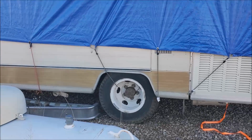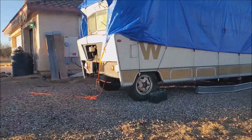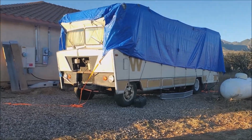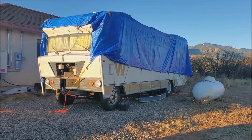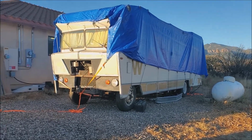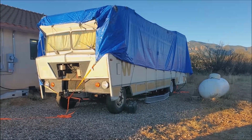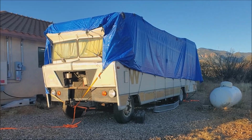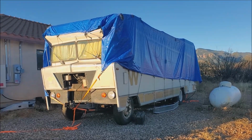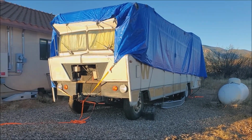Here's the thoughts. Several people have successfully converted these things to four-wheel drive. I think that's the direction I want to go with this. Eventually, we can obtain running gear from a 4x4 dually. We can swap a dually front axle in, a dually rear axle, do a divorce mount NP205 transfer case. Now we've got easily sourced brakes, disc brakes, and if we go with Super Duty axles or F550 axles, they're going to be bigger disc brakes that will stop this thing better than the original drums ever could think of.